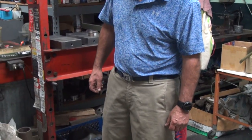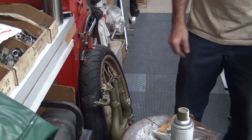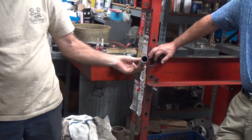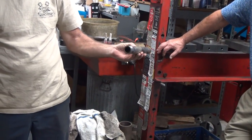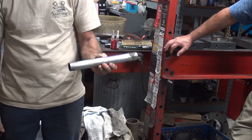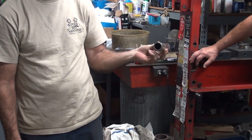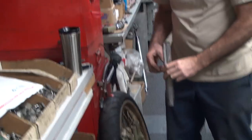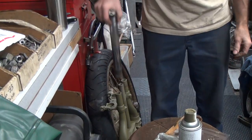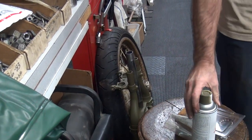How about a crow plate or a fork tube? What size fork is that — thirty-three, thirty-two, thirty-three and a half, or thirty-five? Thirty-three and a half. So would you like to measure it? We don't do metric around here. Is it one and five-sixteenths or one and three-eighths? I'm calling it one and three-eighths — it's gonna go right on.